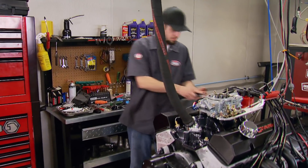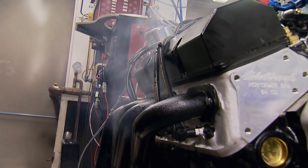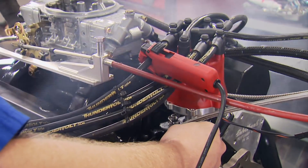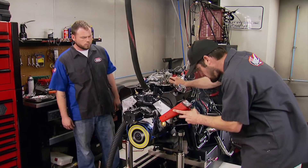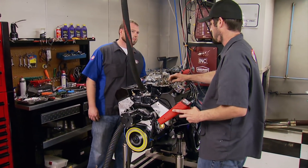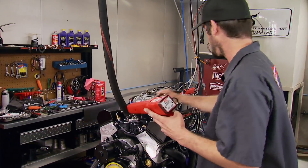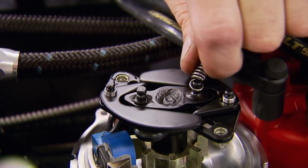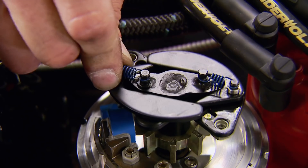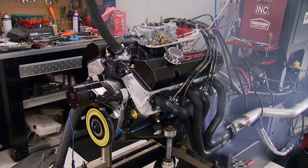That's the sound John needed to hear, but the painted headers need time to cook a little — he sprayed them with 500-degree paint and we're already a little above that. Despite the carb swap and the smoke, we're almost there. You can actually hear a hesitation, and here's why: the springs are heavy for a slow timing advance, so we need to swap them out for lighter ones.